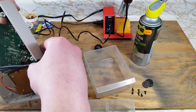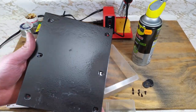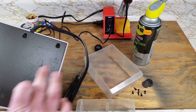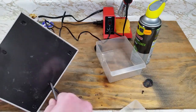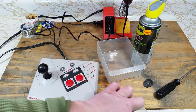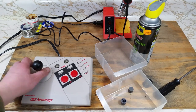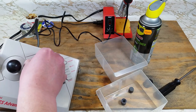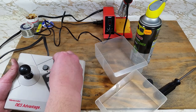Putting that cord in will be a little tricky, seeing as how we cut that rubber part. You can see the cut we made, but most people will never notice it. My paint job isn't perfect, but it's a lot better looking than what it was. Now we'll get the six remaining screws in for this bottom plate. Flip over the controller to get that joystick ball screwed back on, and the two washers and nuts for those turbo dials. Again using a 10mm socket bit, we'll get those in finger tight. Turn the dials all the way counterclockwise and align those dots with that arrow.